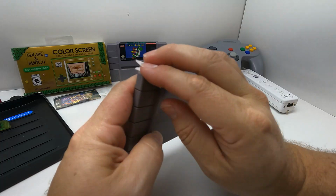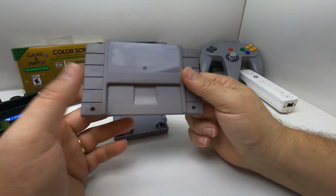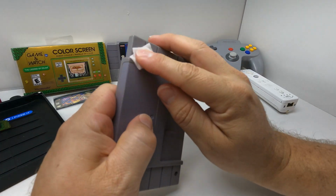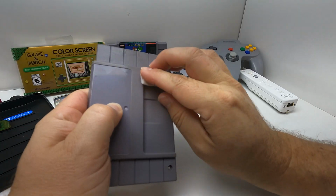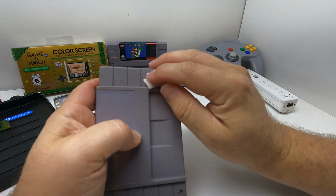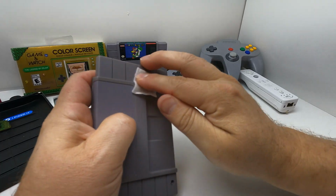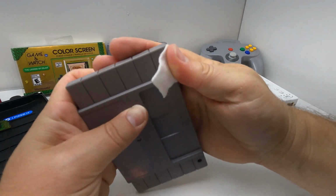I don't remember who figured it out. Someone figured out if you put, is it bleach? Yeah, it's essentially bleach. You put your plastic in bleach, counterintuitively put it under UV light, which are black lights, it will bleach it back to its original color. So that's essentially what you do. The way that I do it, we'll just show you how I do it here in a second. I'm gonna finish rubbing this down just to see how much of a difference, if any, it will make.